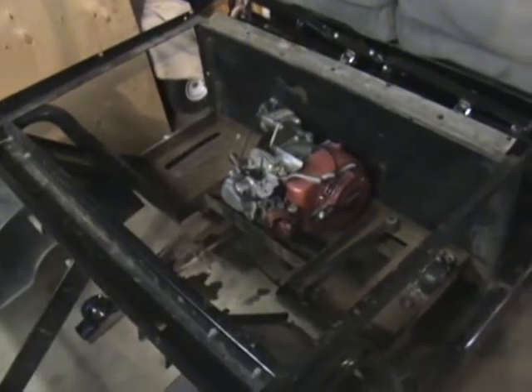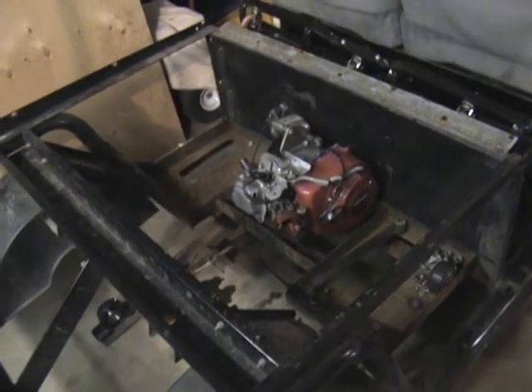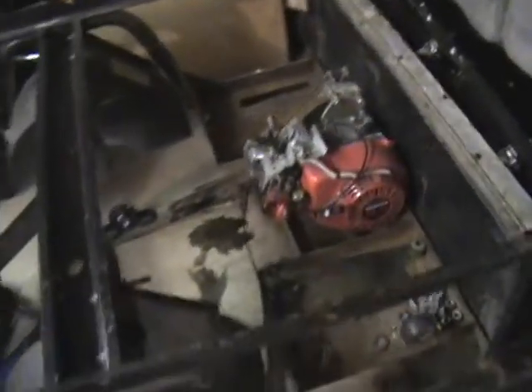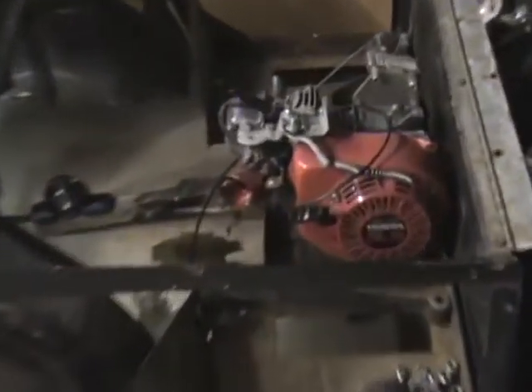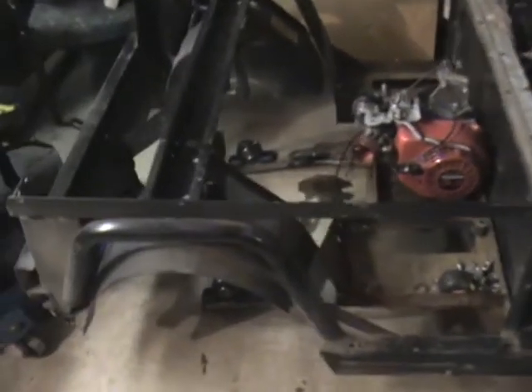If it's on alcohol, it does about the same RPM but it makes more power — about 20 horsepower on the dyno. It's a pretty serious little motor for being just a little 5 horse. Originally it can handle 4 times the power.